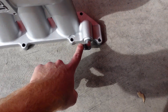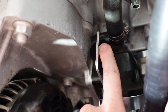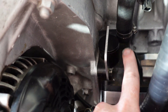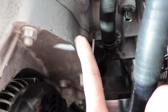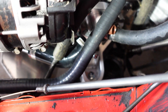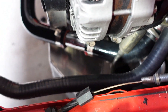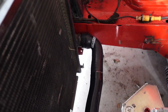It comes through and attaches underneath the intake. I was also able to order a cap for the radiator for the second hose on the plastic piece, since we have the swivel neck. It comes with a little plate that holds the cap down so it won't pop off. The final piece is the bottom radiator hose, which attaches to the swivel neck and then comes down in a U-shape into the bottom of the radiator.